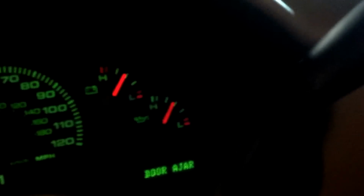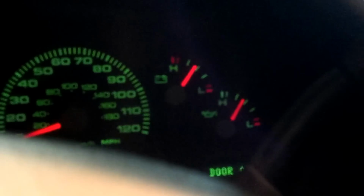Oh yeah, look at that. Everything's so much better. Voltage is staying good. Now this is something that I got from Stix Audio. It's a little voltmeter you plug into the cigarette lighter. We're staying right at 14.5, which is beautiful. We're fluctuating 14.4, 14.5. You're talking about a half a volt. Not really much at all.